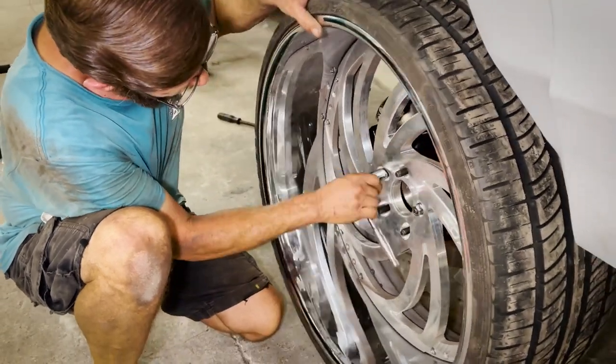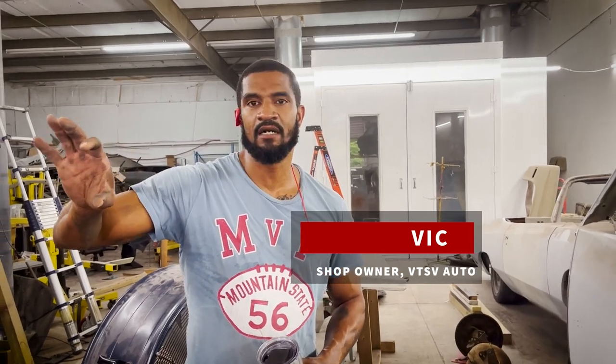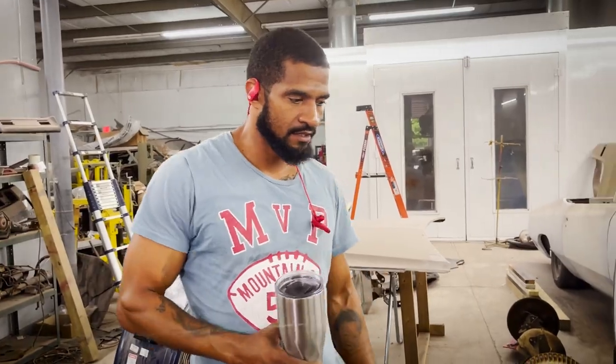Some manufacturers, when you buy the rim, like when we got the rims for the Monte Carlo, they had a hub ring, which is a centering hub, where the aftermarket wheels already got it in there, which fits to the circumference of that circle in the back, so it holds it right center. It centers that wheel to where it's not a millimeter higher this way, because you got a little plate inside of that nut house, you know what I'm saying? If you tighten one down first, all the way down, and then tighten the other one down, you can have it just off. That centering piece is not gonna allow you to do that.